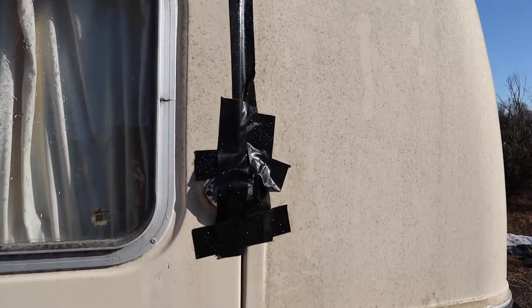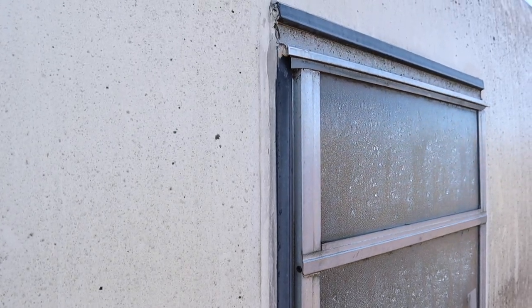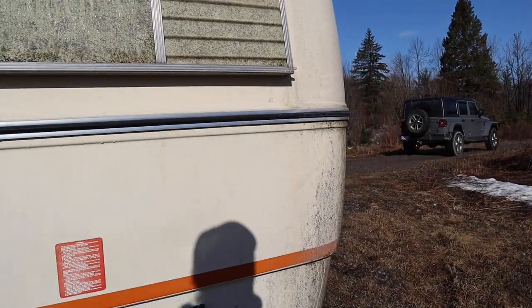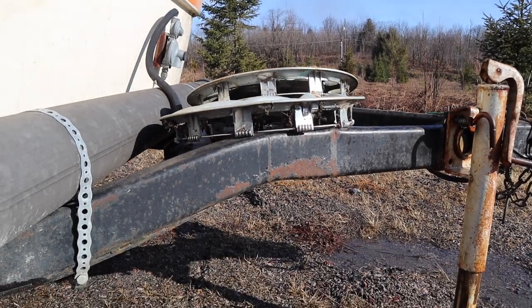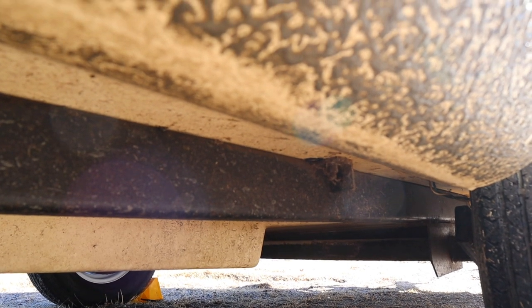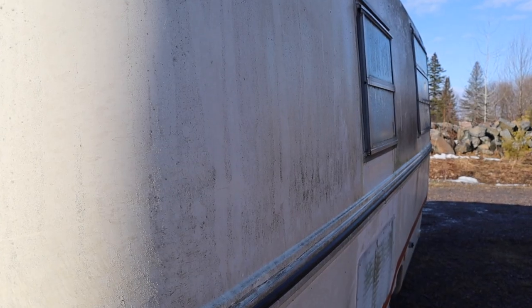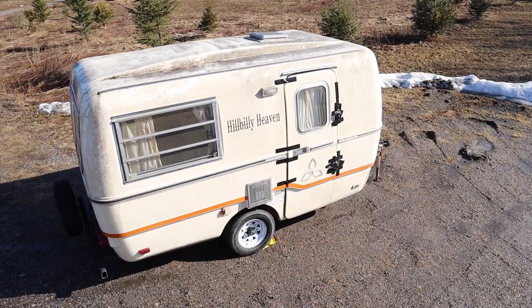The gorilla tape kept the hinges from falling off, but I'll have to do that fix. All the windows are going to be pulled out and new butyl tape seams will be applied to stop any damage from leaks. Leaks in the belly band area are a frequent issue, so we'll have to repair that. I may be lucky with the frame — I just see a little bit of surface rust. The trailer seems to be covered with a good layer of dirt and mold and mud, so let's get that cleaned off so we can have a better view.